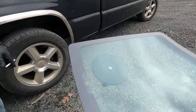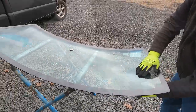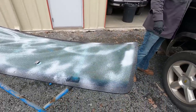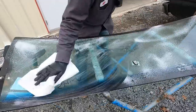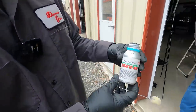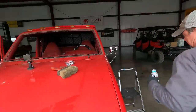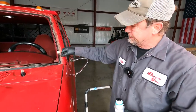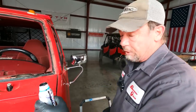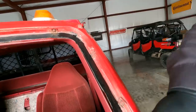A little pro tip. So what's this thing right here? Those are the suction cup handles — makes it easier to handle glass. We just want to get all the oils and residue off where you handle glass; I just use regular old paper towels and rub away. So you're using a primer — what is that called? Beta Prime. That supposedly penetrates down into the metal. It basically, once it dries, adheres to the metal and gives you a good surface for the urethane adhesive to stick to. You want to be careful and try not to drip it, because it sticks pretty well to whatever you put it on.